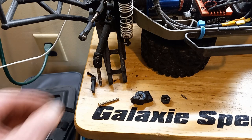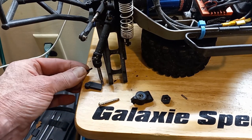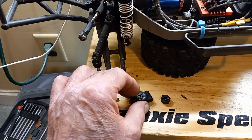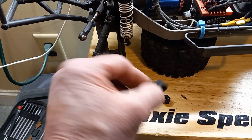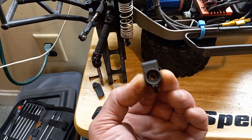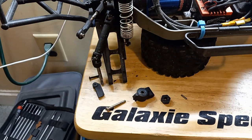Now, as you can see, we've removed the broken-off piece of the rear spindle and the screw that holds it in there. We've also removed the rear hub. There is a washer on the outside — you want to make sure to reuse that, don't lose it. We're going to load the new spindle with two new bearings on the inside and the outside. Don't forget this little washer — it provides the correct spacing.